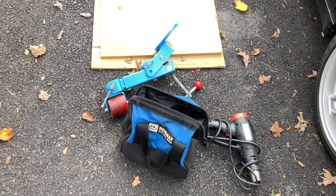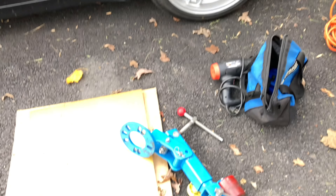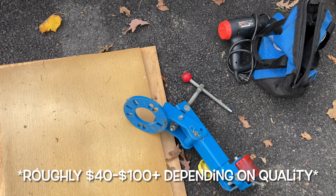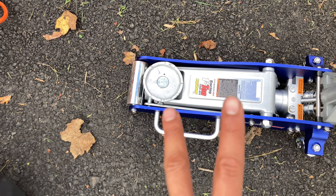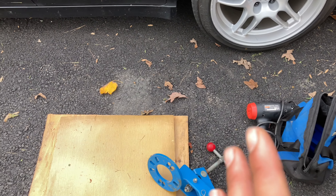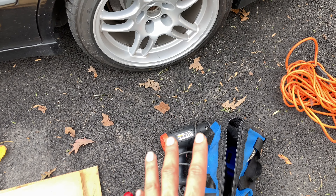The main thing you need is a fender roller — I borrowed this from my friend Brian. I'll put the price in the description. We've also got a heat gun, extension cord, and a jack. I'm not too worried about a jack stand since I won't really be under the car. The plan is to jack it up, take the wheel off, mount the fender roller, and start heating up the quarter panel first.